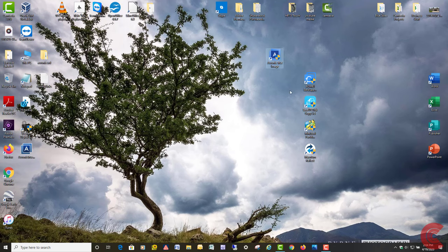Now, there is other software you can download. For example, this one here, AOMEI Backupper Standard. It's completely free. However, it clones your old drive onto the new SSD through the USB. Works fine, but it takes a really long time, and it does it right within Windows. So you got a lot of files in use when your OS is running, and it's just going to make the cloning process take longer and possibly even fail if there's any issues with background programs or system files that are in use and that type of thing.